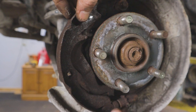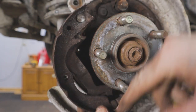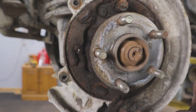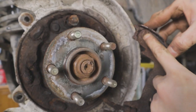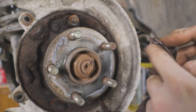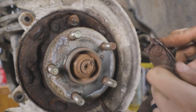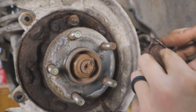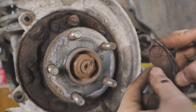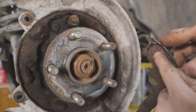Lastly, you'll notice this shoe is going to be attached to your parking brake cable, so you need to turn it 180 degrees. You'll notice a bracket on the inside with a little horseshoe retaining clip — get a flathead screwdriver in there, turn it sideways, open that shoe clip up, and slide it out so it will slide off the pin. Don't worry too much about damaging that horseshoe clip because your new hardware kit will come with a new one.